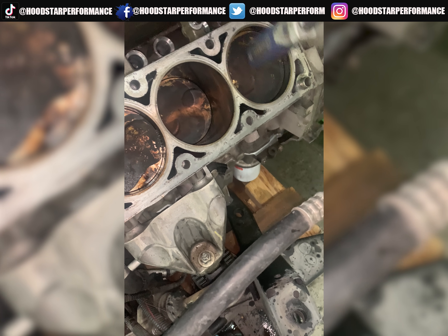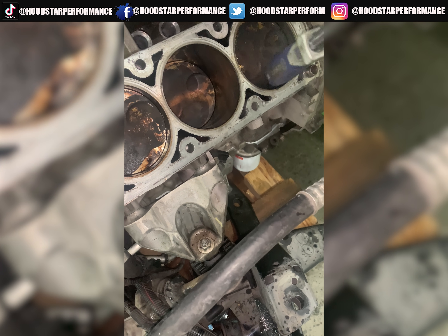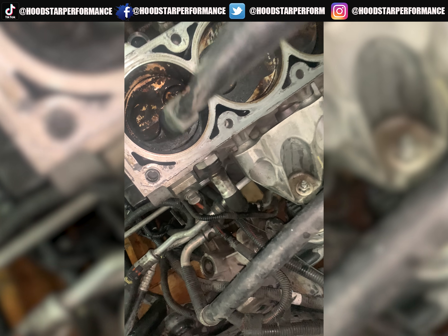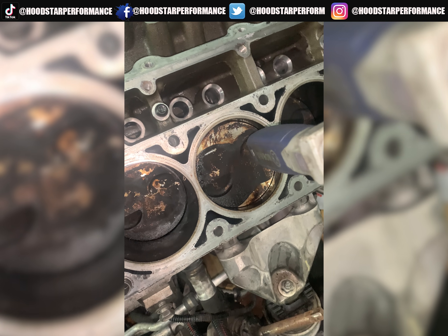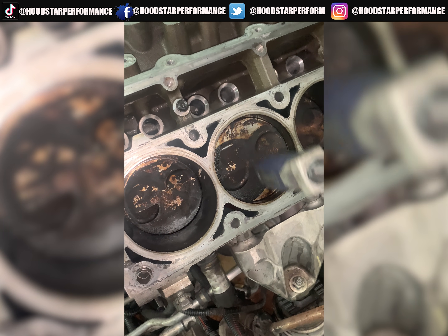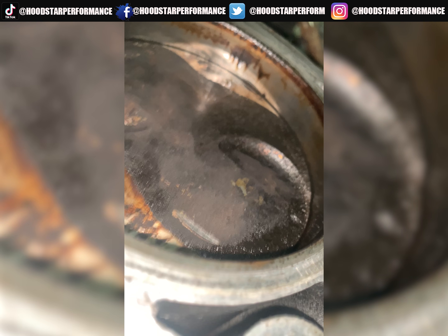Wow, that one — these bearings are going on the crankshaft. I wasn't expecting that, but they all are, so they're all getting changed. This one is the worst one. Hear that? It just went down. I can see all that play there. Wow guys, I didn't even see that play before — I just now noticed it.